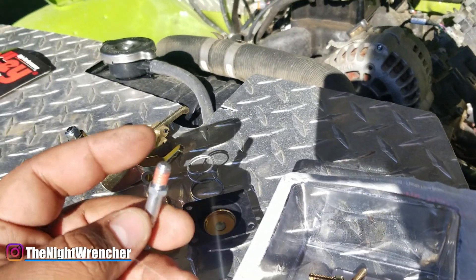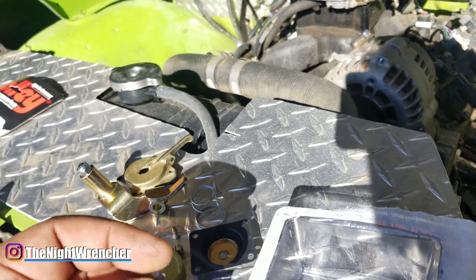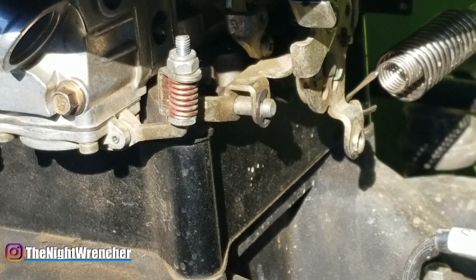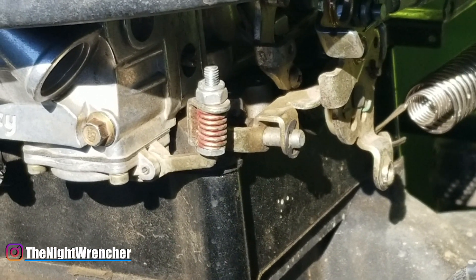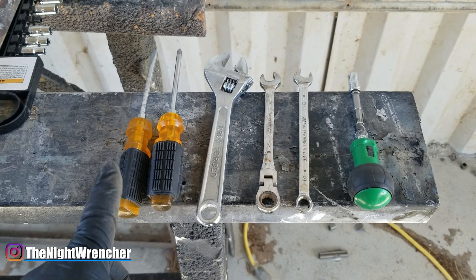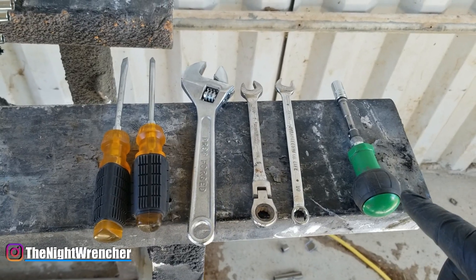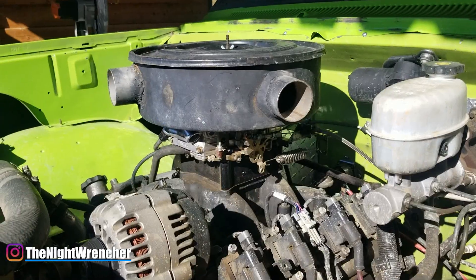Normally the cam I like to use is this brown cam, but it also comes with this yellow cam. I'm not sure what the difference between them is — they look pretty much identical — but I'll be using the brown cam because that's what I always use for these swaps. The last couple items are the little pivot arm where you slide in the accelerator pump arm, along with the associated clip. This is more of a retrofit item; you don't actually have to install it if your carburetor already has the stud built in. Mine already has the correct stud and clip installed, so I just need to undo that and take it off. The tools you'll need are: a flathead screwdriver, a Phillips screwdriver, an adjustable wrench for your fuel rail, a 7/16, a 3/8, and a 5/16 socket or flathead screwdriver to remove the fuel bowl off the carburetor body.